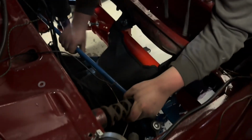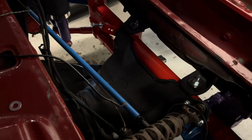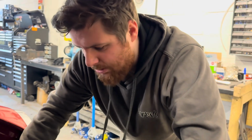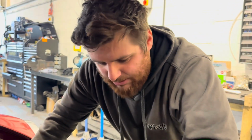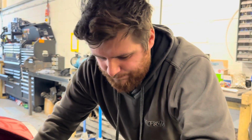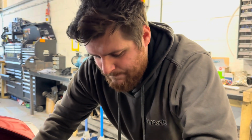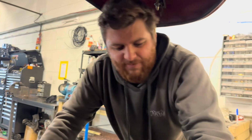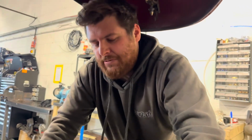Which is nice, it means we're going to line it all up at that height, I mean, it'll be perfect. We're tracking something like this one the same, it's way off. Brake pipes as well. So, it's pretty much on. Got a beam on, all bolted up, that's nice, steering gear on. Mostly tightened up, a couple of little bits turned and adjusted so it's sort of facing the right way. Got to hook up the brakes. Can't bleed those yet because we've got to do all the rears as well. But we're that close to putting some wheels on it and testing it on the floor and seeing what it looks like. I need to go around now, do a bit of a final bolt check, make sure stuff that needs to be tightened down has been tightened down now anyway.